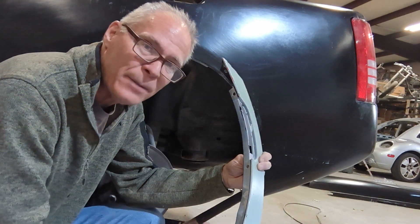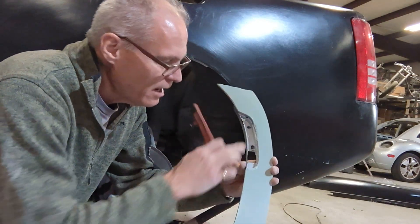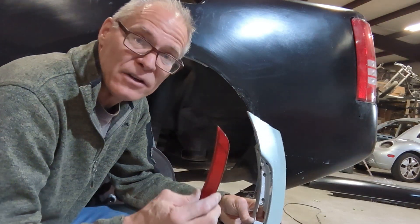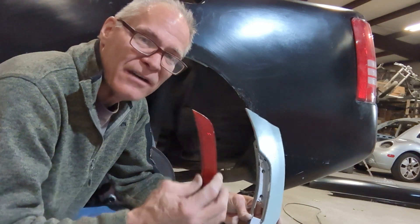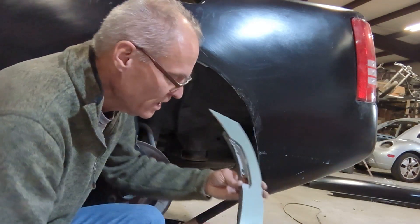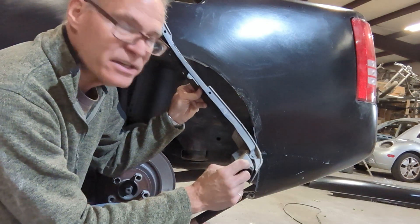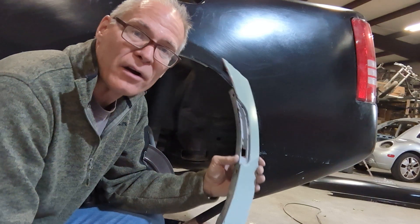And that's what I like. If you're doing a wide body kit, you don't need the light cut out because you're going to be putting this light on the outside of the fender flare. For those earlier 11 to 14 cars, if you run the wide body kit, you're going to need the 15 to 20 running light that mounts on the back of the wheel. So keep these mounts for sure. You're going to use especially this little bottom piece — see how I cut it off? — to mount the wheel well inner liner. It just makes for a much quicker build.